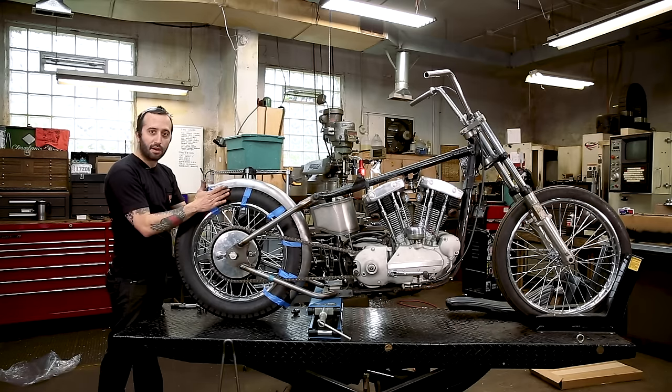These flathead bolts do a nice job of centering everything up. And if there's a little bit of slop in there, it's close enough. Sometimes I'm not actually indicating the center of the hole on the other side with the bolt. If it was going into something threaded, it'd be much more accurate. But since it's just a through hole, it's not going to be super accurate, but it's going to be close enough where it's not hanging over on one side to cause you trouble when you're trying to bolt this in later.